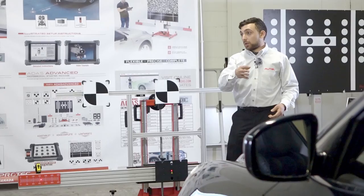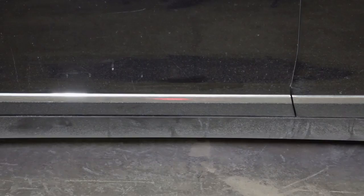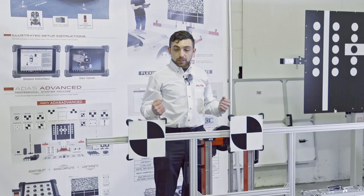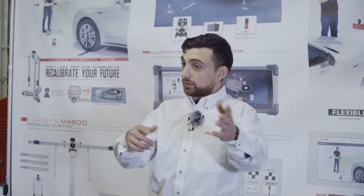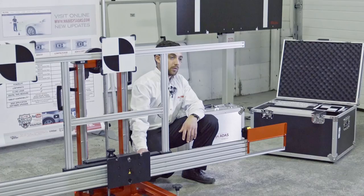This tells me that my crossbar is now completely centered to the rear driveline of the vehicle. We open up the mirrors — these reflect our laser beams back to the rear of the vehicle. The reflections are currently going toward the passenger side, so we make an adjustment to the pitch or angle of the crossbar, and as that adjustment is made, the laser moves left and right.